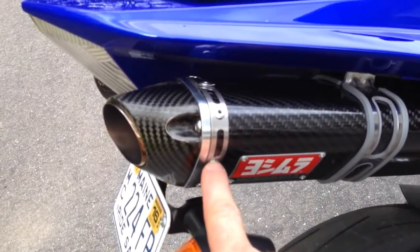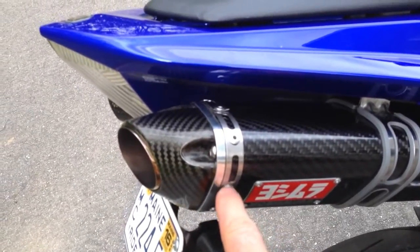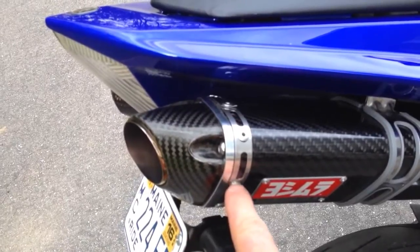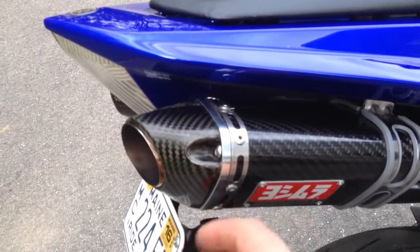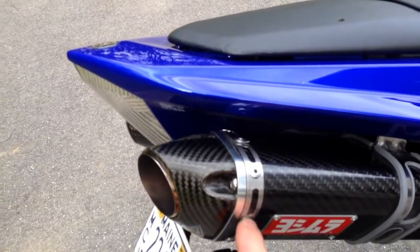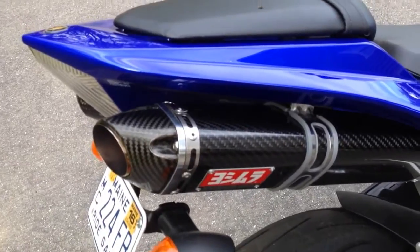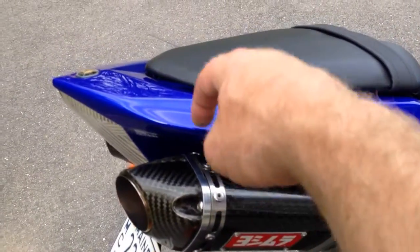right down the center. After you drill the rivet out, the head of the rivet will come up. You take a punch and punch the center of the rivet. With the head off, there'll still be a piece in there. You grab a punch or a very small Phillips head screwdriver. That's what I used, both a punch and a Phillips head. Took my time, and you punch out each one of the rivets all the way around.